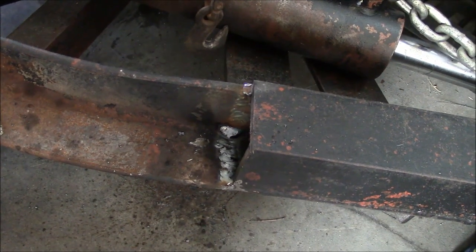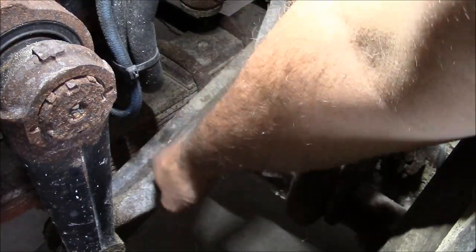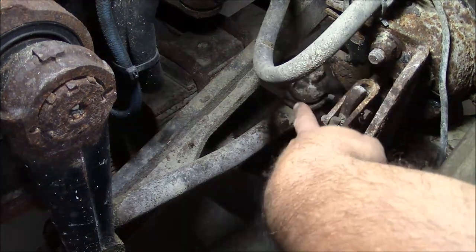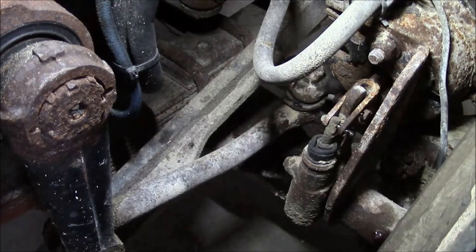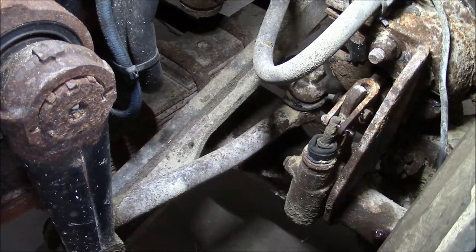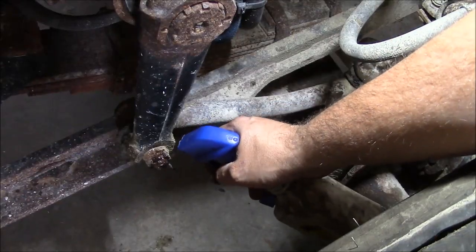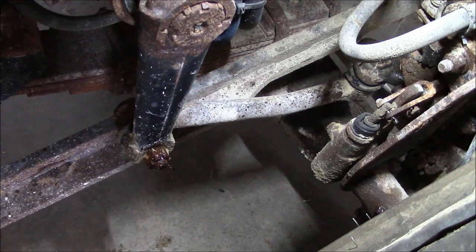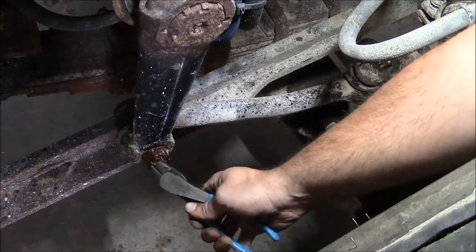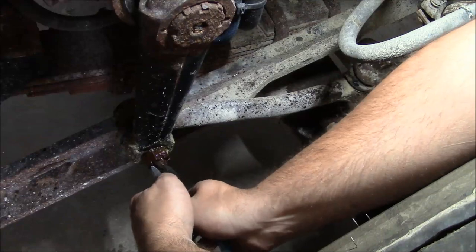I've got about an hour into this, so that's not too bad. We'll have to take a look at this drag link — it's this piece right here. Just turn the steering box a little bit and you can see it down here. That joint is completely worn out. It sounds like the whole steering shaft is goofed up too — it's got a U-joint out of it. We'll just fix what we're told to fix and note that for next time. These nuts and cotter pins are looking pretty mean — I don't think we'll ever get these cotter pins out. We'll probably just have to cut them off.